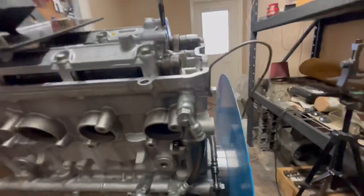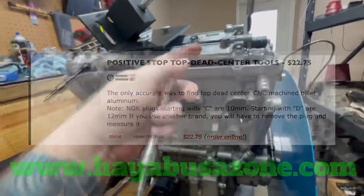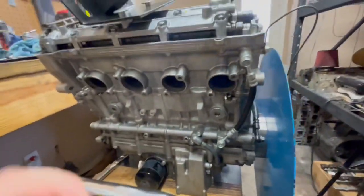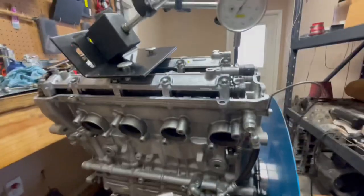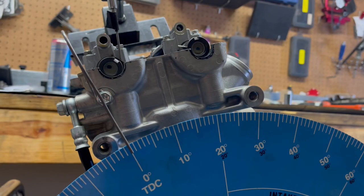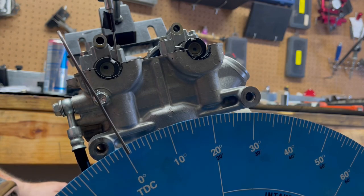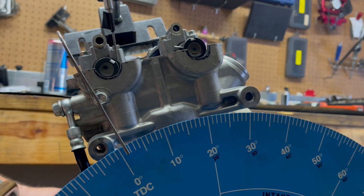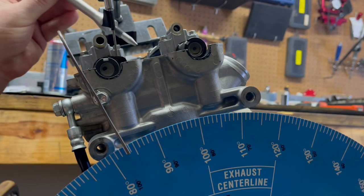How we do this is with one of these — this is called a piston stop. What this does is once you roll the engine past, you want to rotate the engine 90 degrees and then thread this in. It's just a fixed point that stops the engine the same degrees before top dead center and after. So first thing you want to do is rotate it about 90 degrees, because if you put the piston stop in right now the piston's at top dead center so you won't be able to thread it in. Just go ahead about 90 degrees and then insert your piston stop.